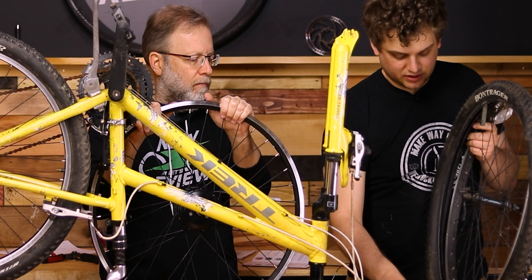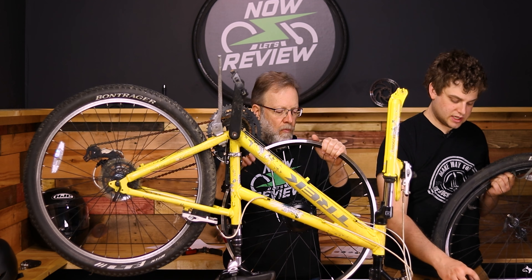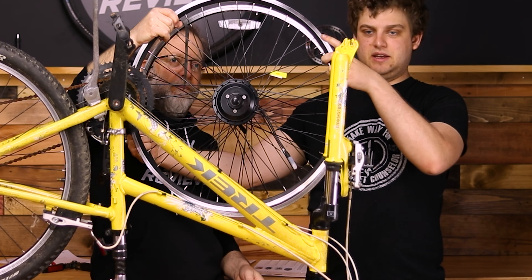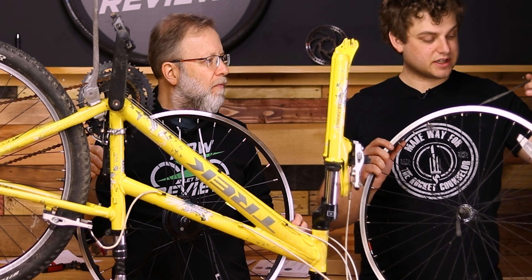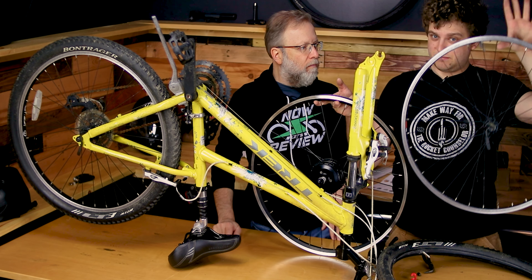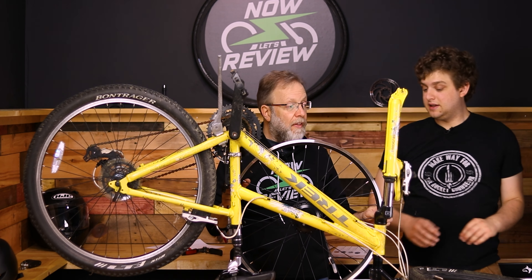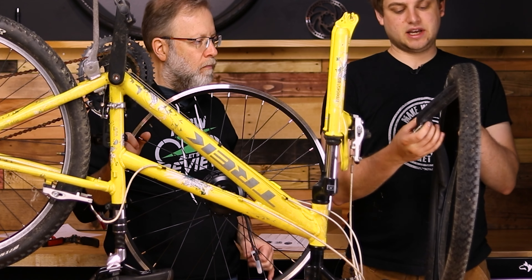I'm removing the tire from the wheel. This is a tire tool — they are very cheap and very helpful. So if you ever need to remove a tire or replace a tube, you should definitely pick up one of those. Sometimes they come with your new e-bike kit. So now the only thing I have to do is pull the tube off. There's a little nut on the bottom, so I'm just going to loosen that so the tube will come off the rim. When you're on the Switch website, they ask you questions like what are the colors of the spokes and what is the color of the rim — and look, it's a perfect match. Same wheel basically, only this one has the hub motor in the middle.